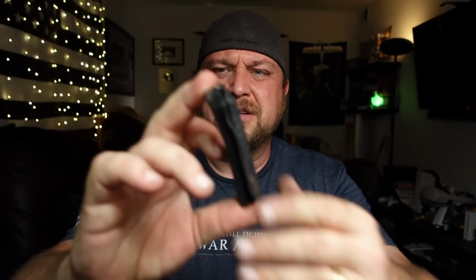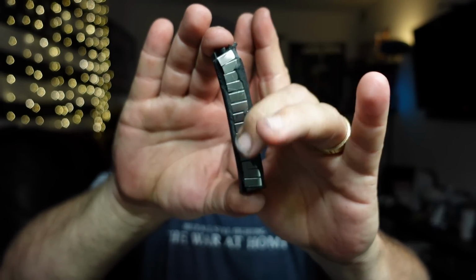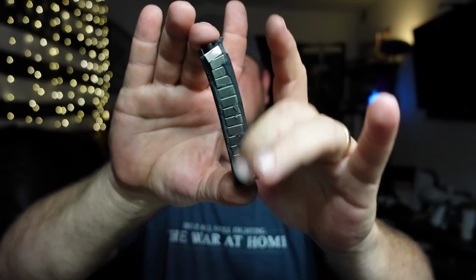Another note from installation, the weather stripping on the side here, I couldn't really show it when I was recording it, but these little teeth right here, these little stainless steel spring jobbies in here, when you're cutting this at the top here, try to cut between them. It'll make your life a lot easier instead of actually trying to cut one in half. And when you're peeling it off, you kind of want to fillet this area from the weather stripping, peeled apart, so it kind of leaves a little rubber behind. I mean, or you could just cut the whole thing off, whichever is easier for you. But like I said, at least this way here, you're kind of retaining that weather stripping in the back. But yeah, the whole system by itself, I think, is a pretty good deal.